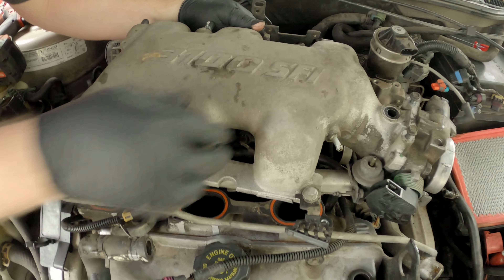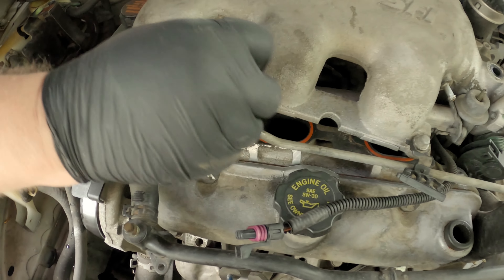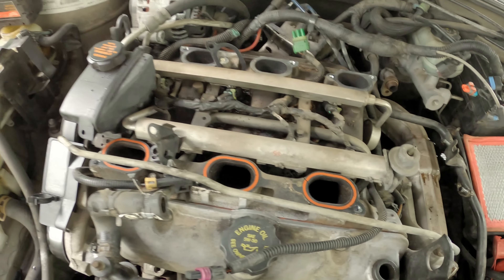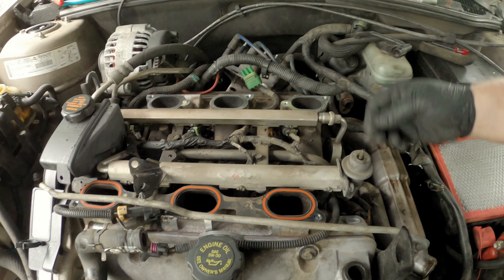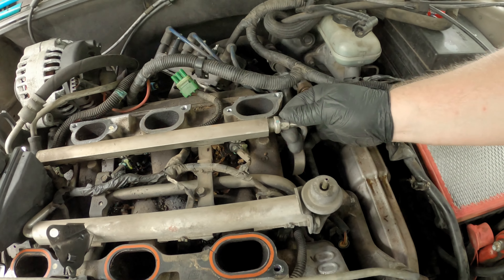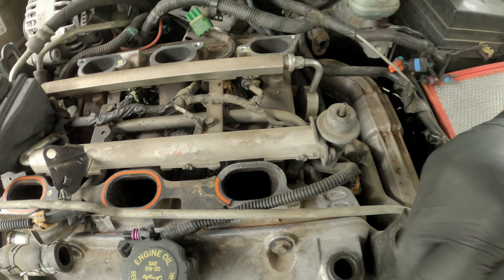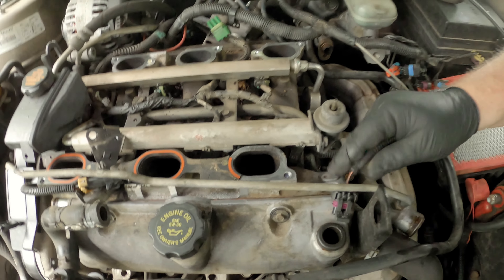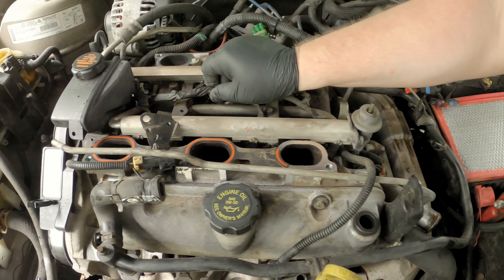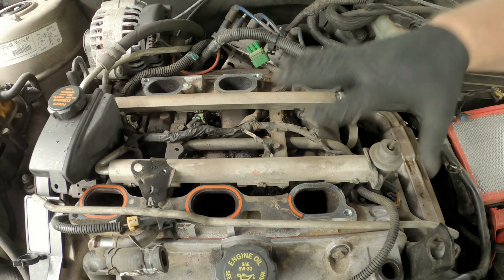Once you get the plenum out of the way - I forgot this actually needs to be pulled through, or you can just take this bolt out and leave it there for right now - and then just take all this out. Next we're going to be removing this fuel rail. I've already taken these loose and they'll just come out of the rail. The rail is held down by these two bolts, and your harness here goes to the injectors as well as to the coolant temp sensor down here, so you will need to unhook all of these and pull this harness out of the way.